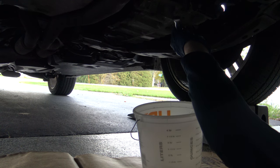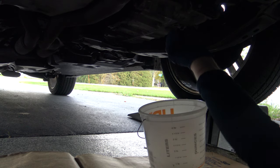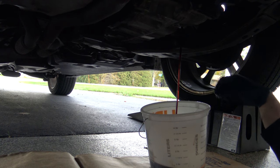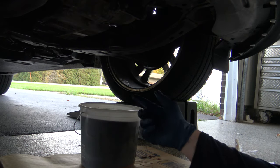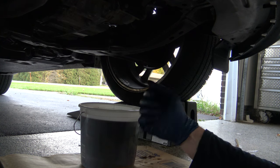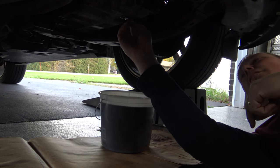You're going to need an 11 millimeter socket — it should come loose pretty easily. Make sure your bucket is centered underneath the drain plug. Go ahead and loosen it all the way and let the fluid drain out. As you can see, it's just finishing draining out — I've got just a hair over four quarts. Whenever you do an oil change on your engine oil, you can easily change your transmission fluid in an extra five minutes. Go ahead and reinstall the drain plug, remembering the position from the face of the plug to the face of the aluminum casting.